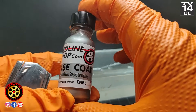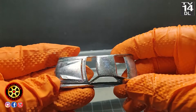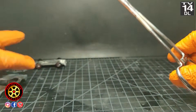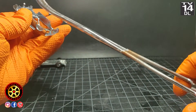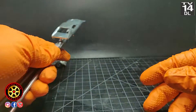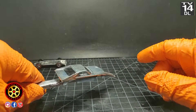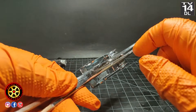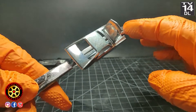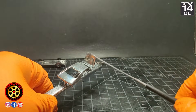I'm going to be using this Red Line Shop base coat — this is the second time I've used it. I did not electropolish, I did not zinc plate. There are some marks where the zinc plate is damaged, so I'm going to be doing an experiment. Now here's something for you guys who like to paint: when you deal with these cars that have the hood open and you turn them around, this usually happens — the hood makes contact with the cowl and there goes your paint job.